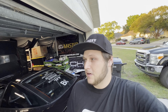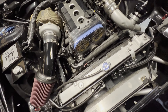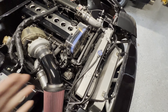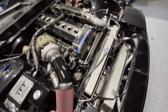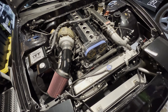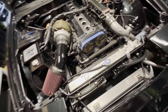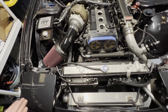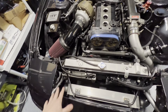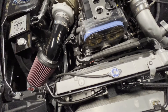We need a new radiator. I'm waiting on one that should be here tomorrow, but while I'm doing the new radiator I'm going to go with way bigger and stronger fans. Right now we have the Flexalite normal shroud built-in fan setup that we've had running for about two to three years. They do the job pretty good, work very well for what it is, but it's time to upgrade. This car, normal JZ stuff, does run hot especially in the summer, especially drifting and driving at high RPM. The setup does work very well and I recommend it for someone on a budget, but now it's time to go to the next level.